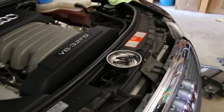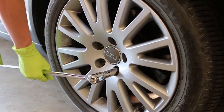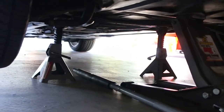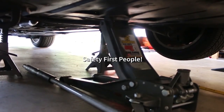Got those pulled out. Next you're going to want to break your wheels free and lift up the car. Then you're going to want to jack up the car, and if you're using your janky Harbor Freight jack stands that are recalled like I am, make sure you also support your car with a jack as well.